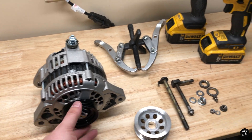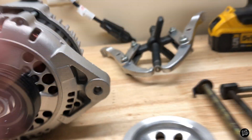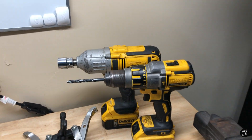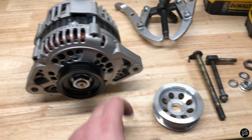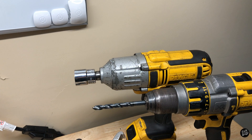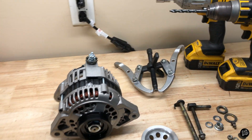All I got to do to adapt this for the SR is to drill out this little hole right here. On the SRs, they have this stud that's threaded and you basically just need to smooth that little bore out in there. I'm going to use a 5/16 drill bit since I don't have metric. And then I just need to replace the pulley. The SR pulleys are a little bit bigger than the KA24 pulleys, so just use a 24mm on an impact, pop that bad boy off real quick, swap it, and that's pretty much it.